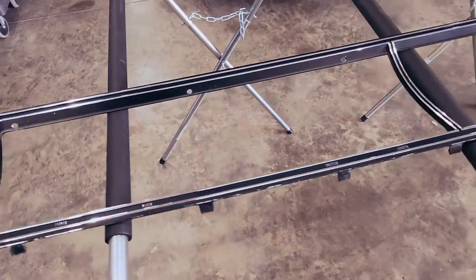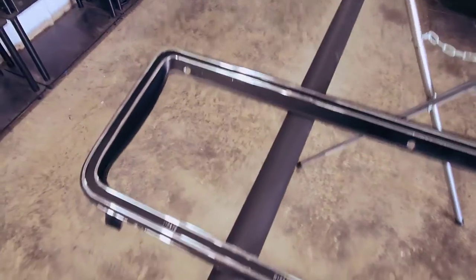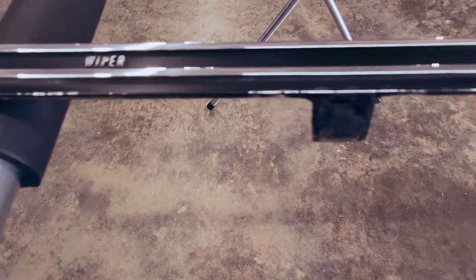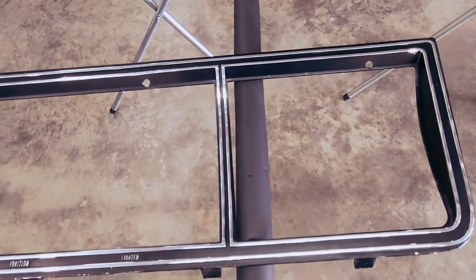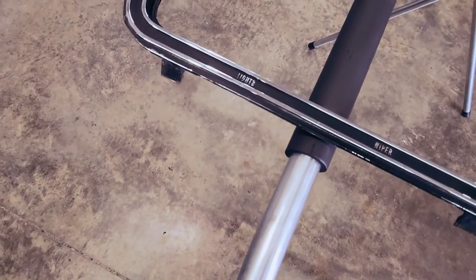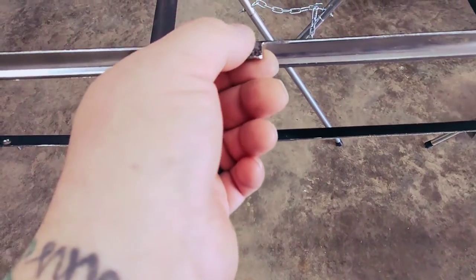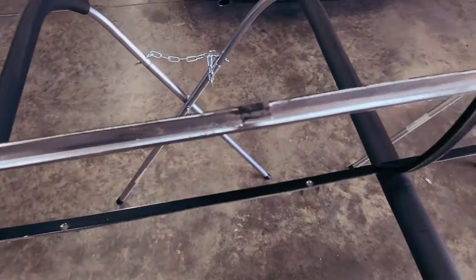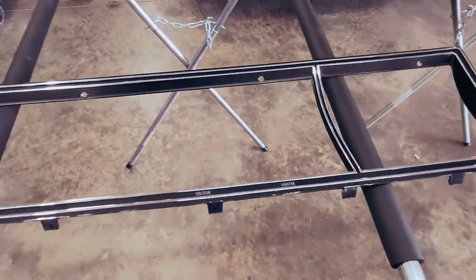And here we have the trim piece that I was referring to up top. Those are the 4 screw holes. And then down here on bottom, those are the tabs that I was referring to that slide down into place. So you'll pop the top out and then lift it straight up so those tabs come out so you don't break them. You don't want to bend it out too far, you'll snap the tabs. And these are actually, I believe, metal. Yeah, that's metal. So if you bend those or damage those, you're going to really be in trouble.